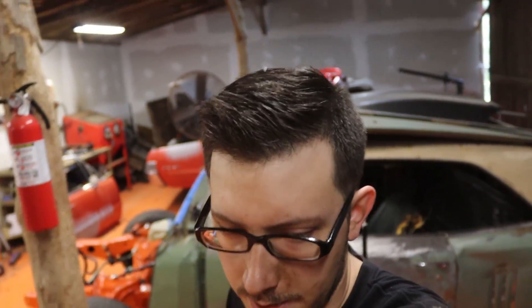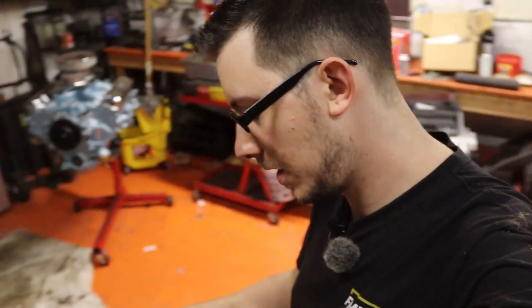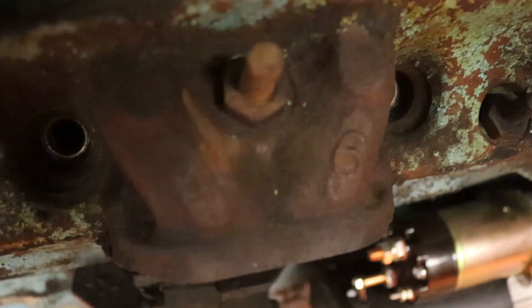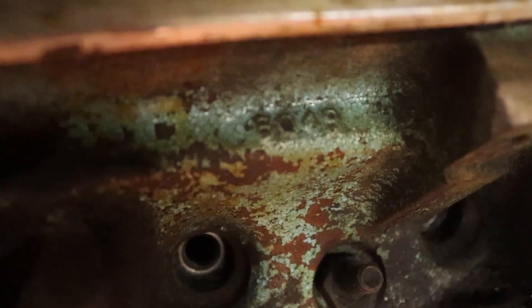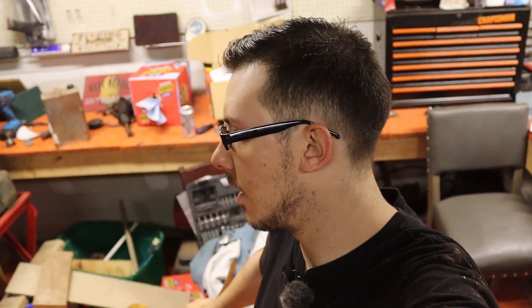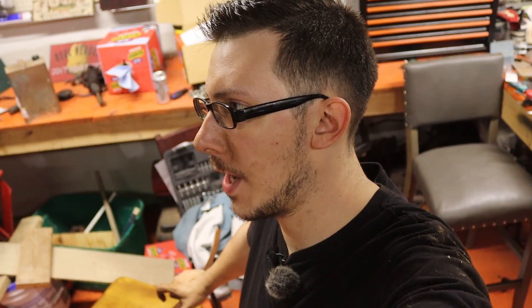That's not all the information you need to know about the Pontiac engine, though. What really matters is what heads are on the thing. Here we have 46 heads with a date code — B049. So this tells us they are 69 46 heads. That should mean small valve, high compression, I do believe.